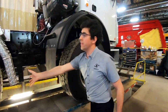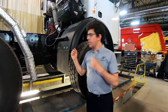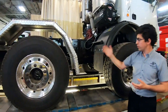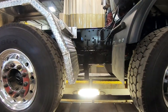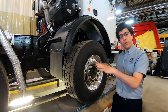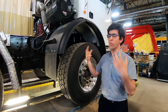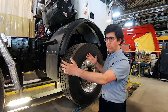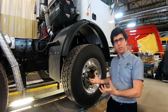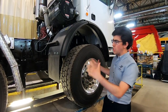Once the chassis prep is done, we start with the installation of the suspension itself. The AMS40T2 twin-steer features an equalizer between the first and second axle in order to balance the load equally between both axles. This allows better stability for the truck, and tire wear is always equal between the first and second axle. Load is equal between both axles, making it much more stable on the ground, especially in curves and slippery conditions.